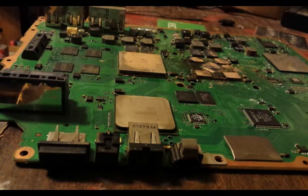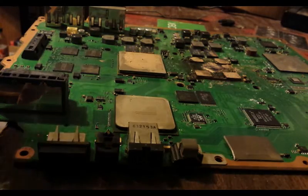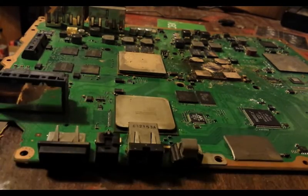What we've got here today is the COK-001 Hardware Backwards Compatible PS3. As you can tell by looking at it, it's pretty well garbage if you can see the GPU. A local repair shop reflowed it, put too much Arctic Silver on, and it spewed over onto the board. For those of you that don't know, Arctic Silver — the keyword there being silver — silver is conductive. So this board just completely shorted out.